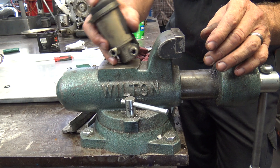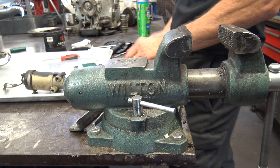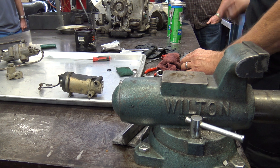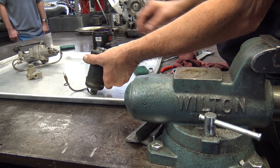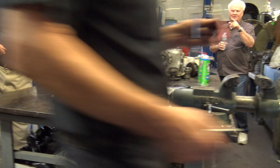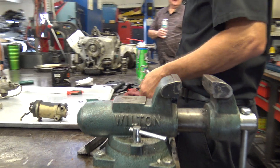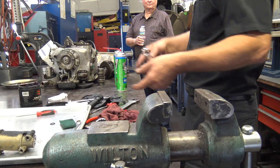So this will cause noises too. If you have a Shadow, you've probably heard that clunking in the rear — when you put it in and out of gear, you'll hear a clunk. And it's not the drive shaft wrapping up, it's this valve right here. So I'm going to grab some pliers — we're definitely going to take that all the way apart. That valve is the thing that makes it clunk. There are two different noises — this is a hydraulic noise.